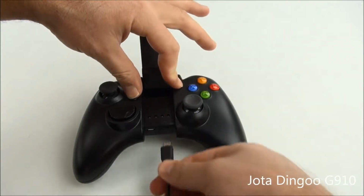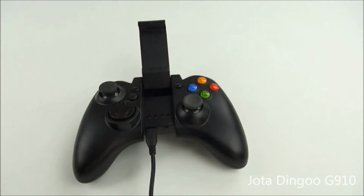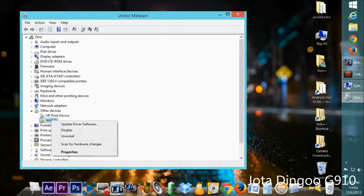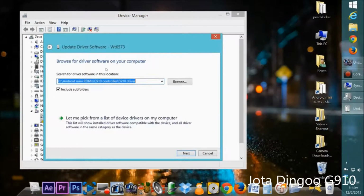To install this firmware, it's a little bit tricky, but I'll try to walk you through it. So first hold start and select at the same time on the controller while you plug in the USB cable. This update is kind of like an Android mini PC, so first you'll install the USB drivers and then you'll update the firmware on the controller. So once you plug it in, you'll hear a ding and you'll go to Device Manager and you should see an unknown device there, and you'll choose Update Driver and then specify the location where you downloaded the drivers to.